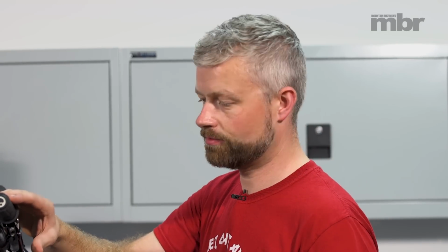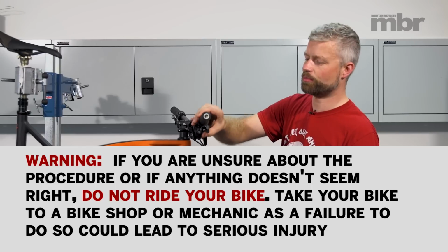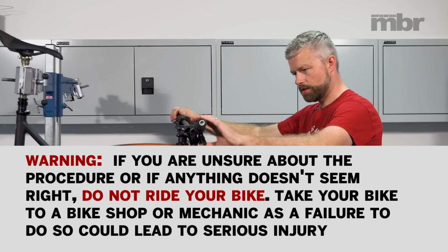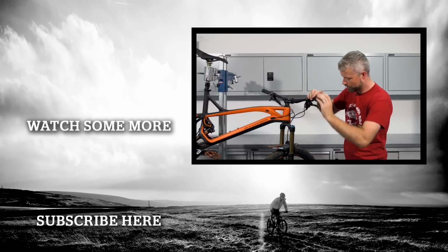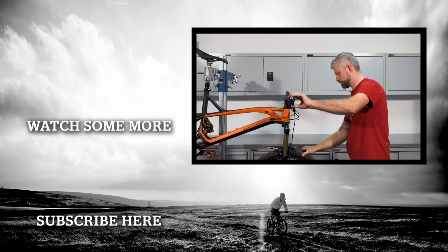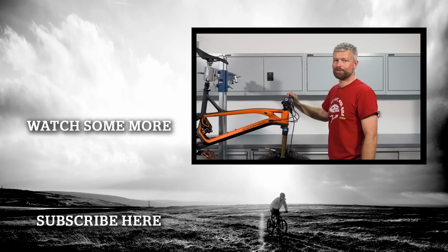With everything back together, we just need to test the system. First couple of pulls of the lever, the first one will definitely come back to the bar, just as we get a bit of pressure built up there. Check the system for leaks, making sure there's no fluid coming out of either of the bleed ports. Should all be good. Go out, ready to hit the trails.